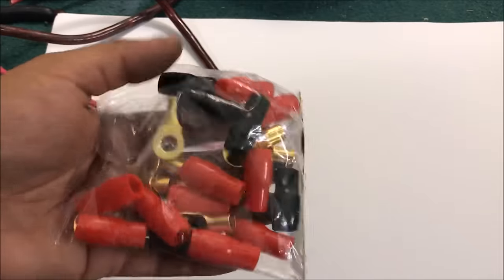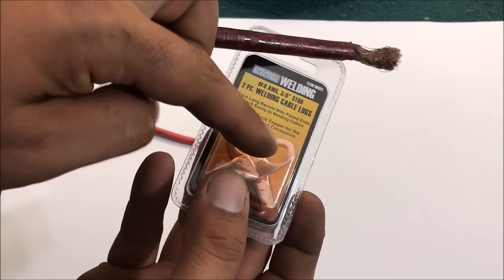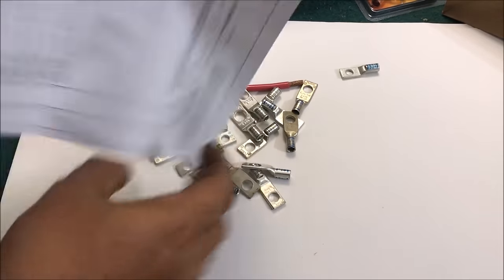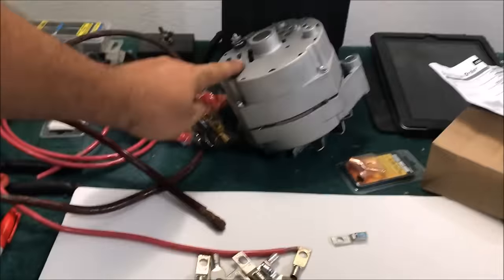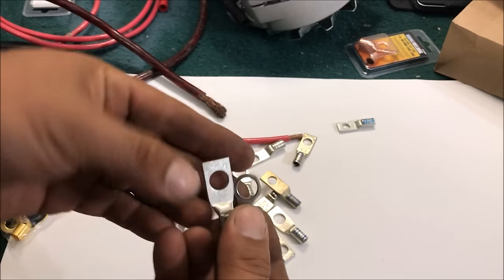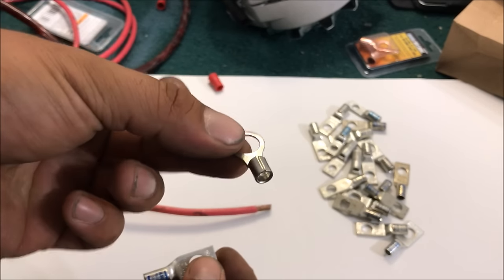I found these at Harbor Freight for number 4 if you absolutely can't find any - but what you really want is to go to an electrical supply store. The reason I made that list is so you know exactly what to buy. These cost $29 from the electrical supply store. When you're doing your 100 amp upgrade or more, you have to have a heavy duty official connector. These are two 3/8-hole number 6 ring terminals - you'd be a damn fool to put the thin one on your alternator upgrade.